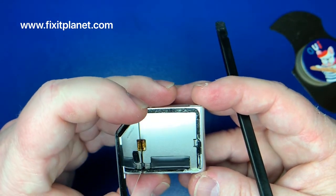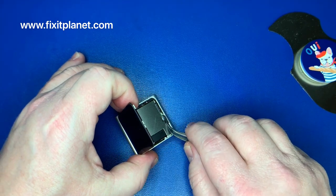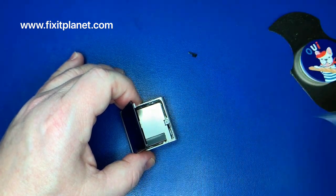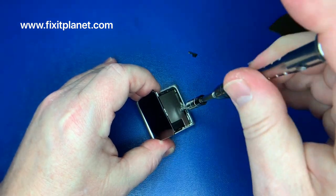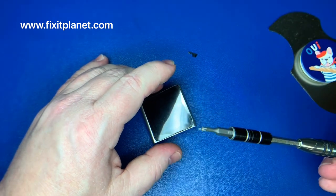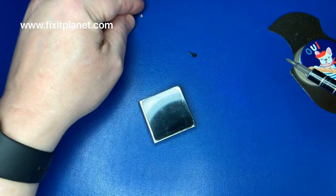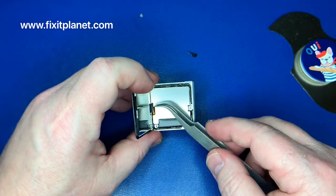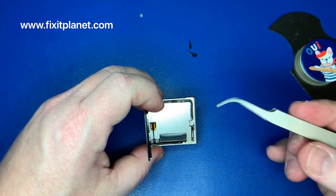You'll see there's a metal shield held on with a couple of screws. There are a couple of little rubber pieces along the edge that fill in a space where you can get to the screw. They're just small, really tiny Phillips head — probably a triple zero or double zero would probably be good enough.